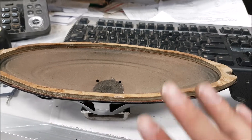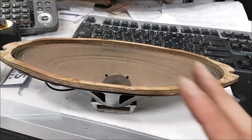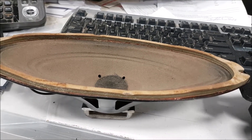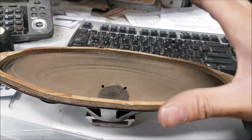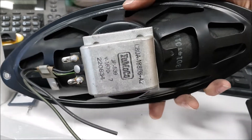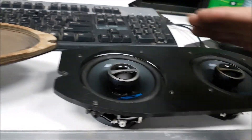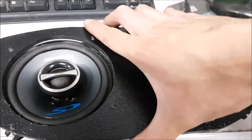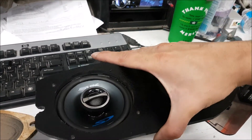For our front stage in the car, we're going to compromise and utilize the area in the center of the dash. It's not the best for imaging because in order to have stereo left and right you kind of have to move the speakers further apart. So we're going to lose that stereo sound, but we're not going to modify the vehicle so much and we're going to keep that factory look. We got to get rid of the 4x10 — it's old, but we're going to keep it just so they still have it. It is the original speaker and you can see it says Ford Motor Company underneath. We made an ABS panel with a notch that slips onto the studs and secures into place, and we have two 4-inch speakers going there. The magnets are quite large on them and we're going to amplify these, giving us lots of control.